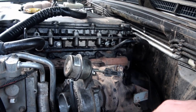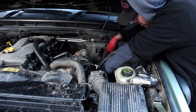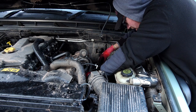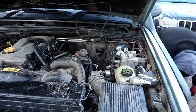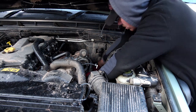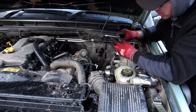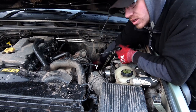I've got all the bolts back on from the turbo to the exhaust manifold and the exhaust downpipe. I've got the two bolts back on the pipe right down the bottom that goes from the oil filter housing down to the sump. Right now I'm just putting the rubber hose and jubilee clip back on on the cold side of the turbo.